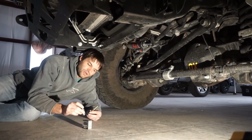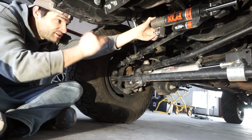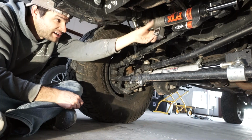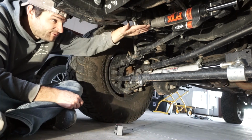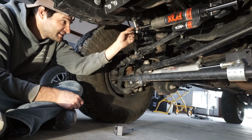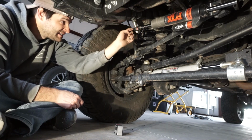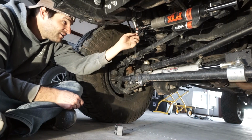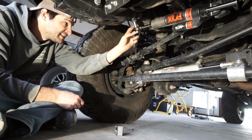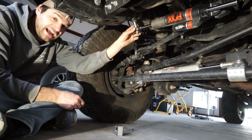So I'll show you what it looks like with it installed when I get it put on there. It reduced our angle quite a bit. We're now at about 11.5 degrees up angle, and you can see it's a lot flatter now with this new spacer. It's a really nice machined piece. You basically take out the machined upper piece, and this replaces it. And the O-rings now, top and bottom, aren't puking out because the angle is much less.